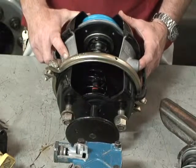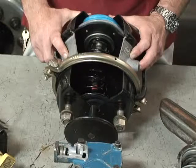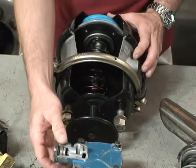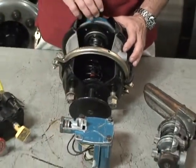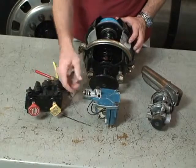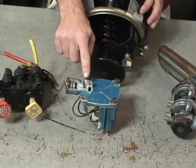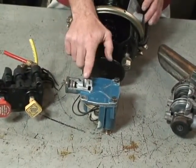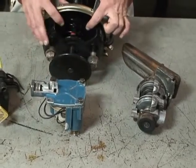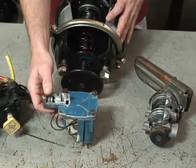So how do they keep the pressures to the safe working limit of 120 psi? By using an anti-compounding system. When we have an anti-compounding relay valve, we have this type of valve on here. This is going to control your parking brake circuit. So our yellow dash button will be connected to the service port on the relay valve. We're going to have an airline that comes from our primary delivery on our treadle valve for our rear brakes — that's the same air that's going to operate your service brakes — and that's on the balance port of the anti-compounding valve.